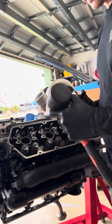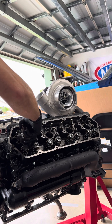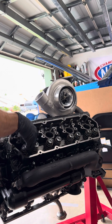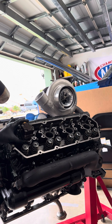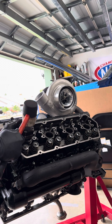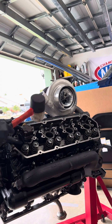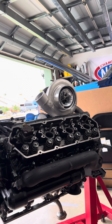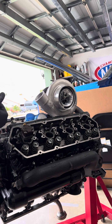You're going to need your injector and a rubber mallet. The injector slides in — I keep the collar up and tap with my hand. Then, with the mallet, you need to tap until you hear the injector ping at the bottom of the head. Do not use a hammer — you will crack the ceramic piece. That ping and change in tone is how you know your injector is fully seated as it bottoms out in the cylinder.